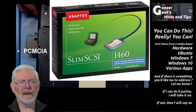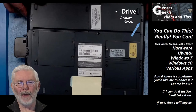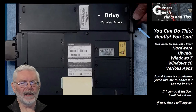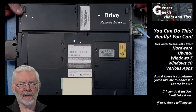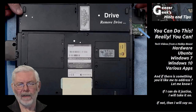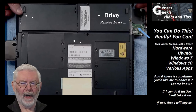What I really want to show you is the ease of changing the hard drive on this older computer. To change it, all you have to do is remove the panel on the side by removing one screw, remove one more screw inside that panel, take hold of a plastic tab designed to pull the drive carrier out, and just pull the drive out of its bay. Easy. However, you're not going to be putting a modern SSD into this laptop because modern SSDs use a completely different interface.